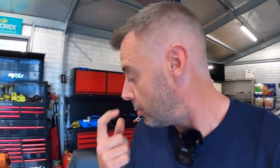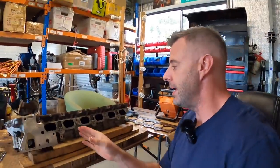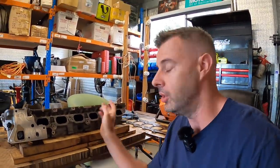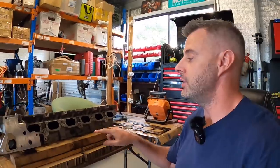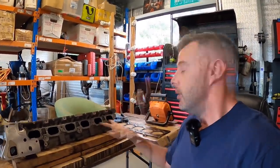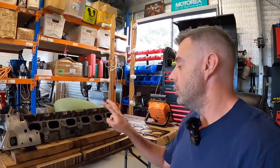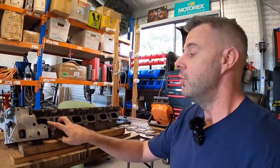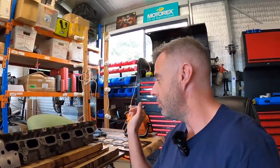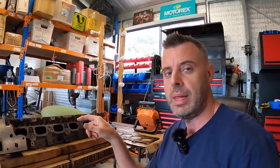So here's the plan: I'll show you inside the cylinders shortly. I've got the head laid out, both cams are off so all the intake valves are closed. I'm going to separate it so two intake ports will be cleaned with the CRC product, two with the Three Bond product, and two will be walnut blasted. I'll put you guys on a stand, grab my phone, and we'll have a look at each of the valves and ports.